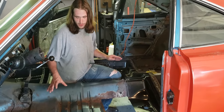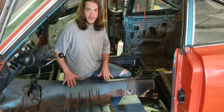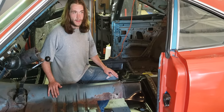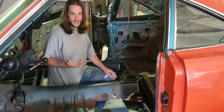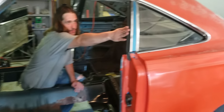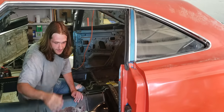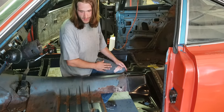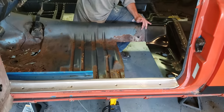With the AMD short pans, the biggest problem with doing the main pan that includes the tunnel is that it's fine for a convertible — you can put the whole pan down in just fine. But this is a pillar coupe, so we have these pillars right here where the windows don't roll down, they open out, and they're not removable. So the pans have to be small enough to slip in with that there — you can't take one huge pan and lay it in here without removing the transmission crossmember and pulling the drivetrain out.